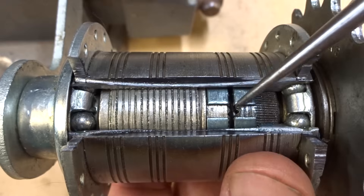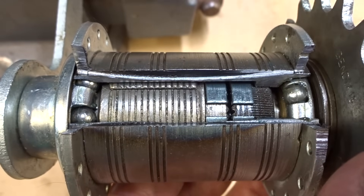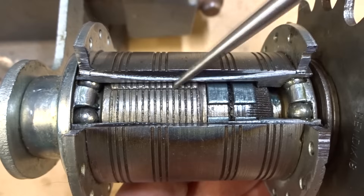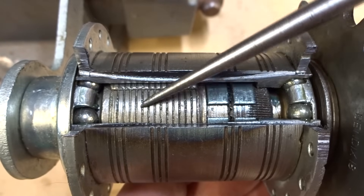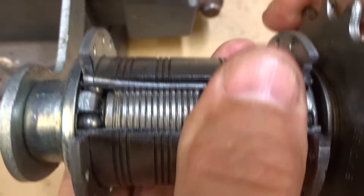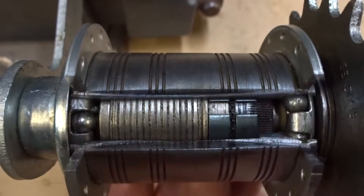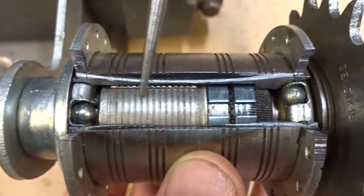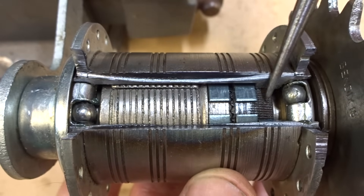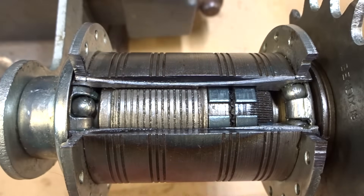And if I want to brake, watch this. As I turn this back, the clutch is going to push back into the spring. These teeth are going to engage inside there between the clutch and the expander. The expander is pushing over to the left and it's pushing these brake shoes out against the inside of the hub — the brake drum. So right now that is just locked in place. Then if I go ahead and release that, I go back into coast mode. The brake shoes are more relaxed and the splines are not engaged against the inside of the hub shell.